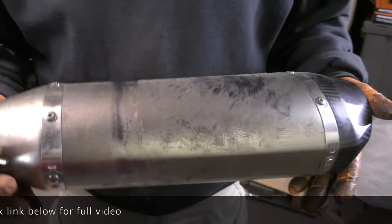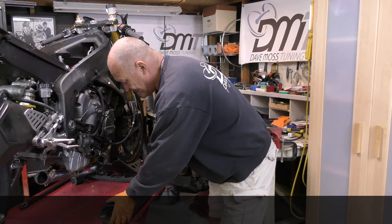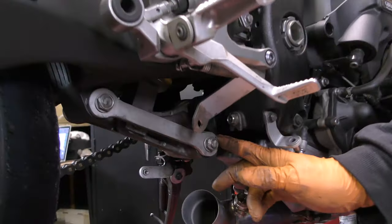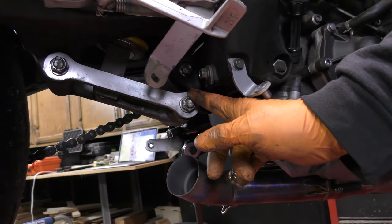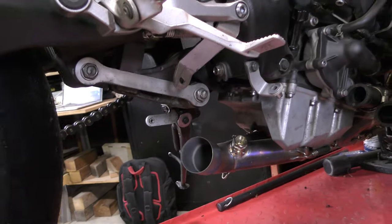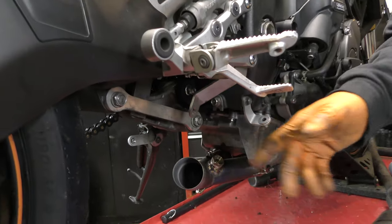That'll hide it and get this looking nice, clean, and pristine again — bit of work ahead, but not a problem. The other benefit of pulling the can is we get full access to the shock and the link plates, and those have to be removed. The bushings have to be removed and greased, so we get a two-for-one: total access to the shock linkage.